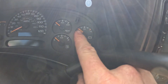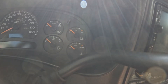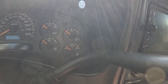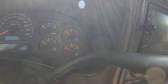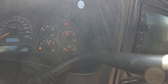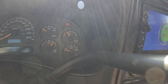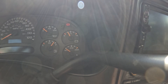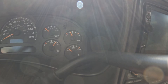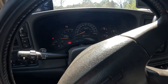What we should see is our volt gauge go up to a little bit past that first mark, which I think is 12, and then after 10 seconds come up even higher — because that means the 100 amps worth of glow plugs have kicked off. The glow plug light is on — there it is, it worked! So we know the glow plug is working now — that is awesome.